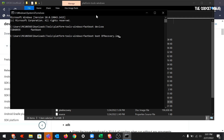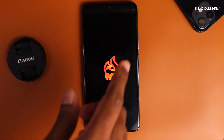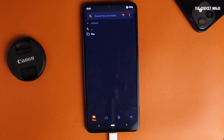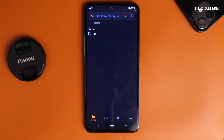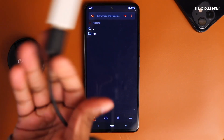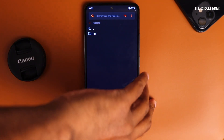The next part is important. You have to type 'fastboot boot OF_recovery.img'. But before that, do one more step: connect your pendrive to your PC and copy that particular OF file to your pendrive — we'll use it later on. As you can see on the phone, Orange Fox will be booted in a few seconds, and it is booted.